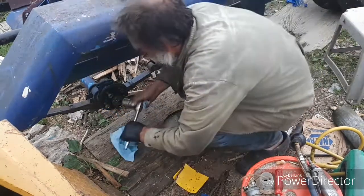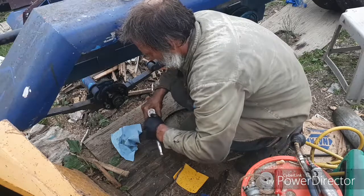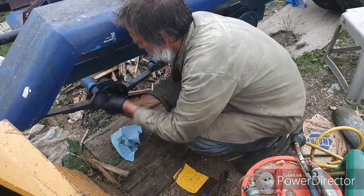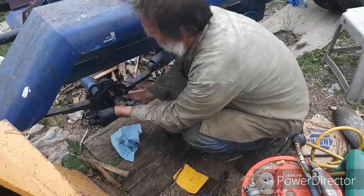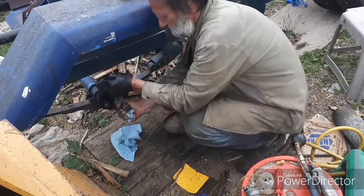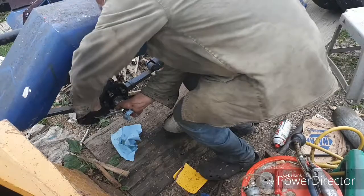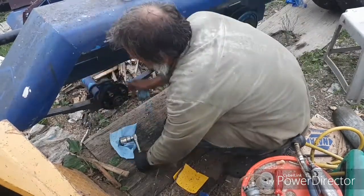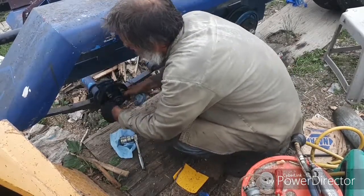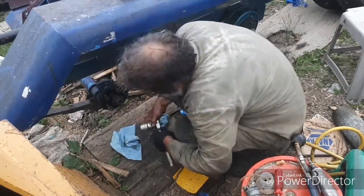So you put the nut on there, the washer, and then what I do, and this is how I was trained in trade school, is put the nut on, start to tighten it, turn the spindle, start to tighten it, turn the spindle, start to tighten it, turn the spindle, and then give it one last good reef so it's good and tight. Turn the spindle. This way that seats any of the bearing races that may not have been totally in flush, and then we back it up a quarter turn.